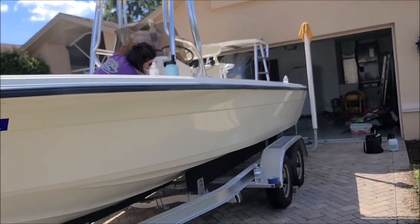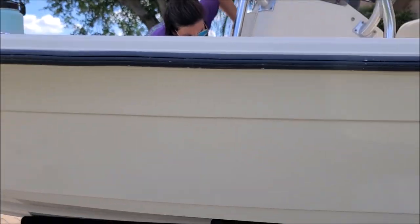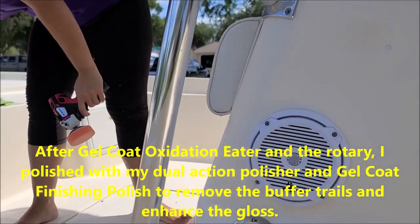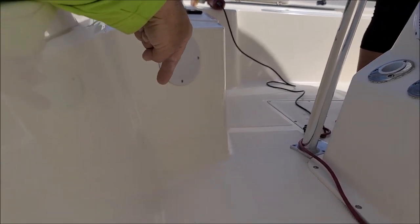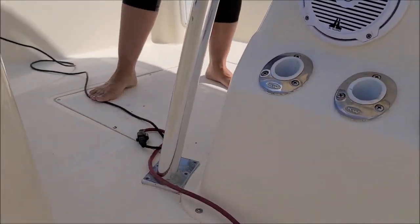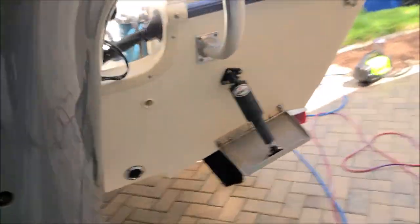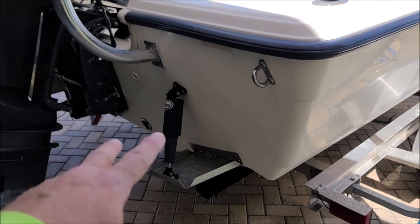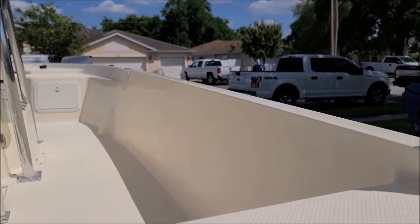We're at a point now where I've got this side completely done. I machine sanded it with 1000 grit and then polished it out with the gel coat oxidation eater compounding polish. We did the same thing to the full interior — Tony's over here now polishing the center console. We haven't polished all of the interior yet, just this area here. We won't be done for probably a couple more hours, but you can already see some of that gloss coming through — it's looking good.